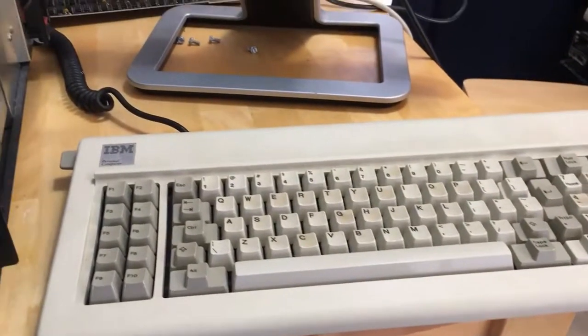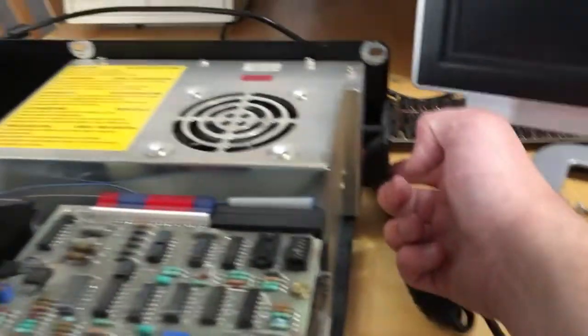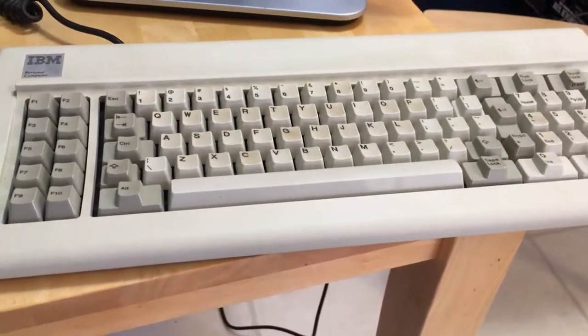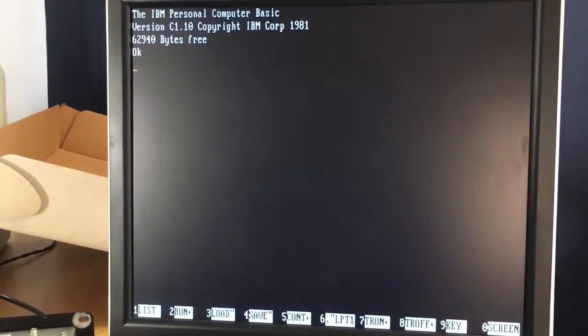Okay, let's power up with the keyboard attached. I haven't tried it yet, so let's see if the 301 error goes away or if the keyboard's broken and it beeps like crazy. Here's that big awesome power switch I love so much on these older IBMs. Okay, no crazy beeping — that means the keyboard isn't totally fried. I have seen that happen before with loose connections or bad capacitors or resistors on the board of the keyboard. No error whatsoever and it's seeking to boot. Sweet — one step closer.